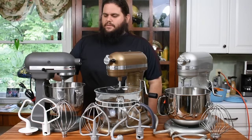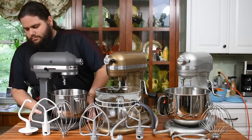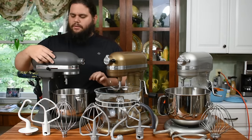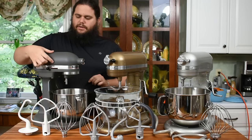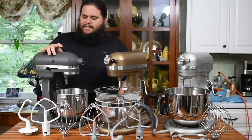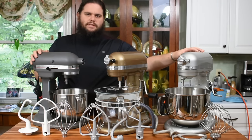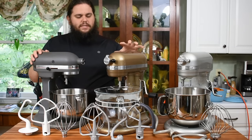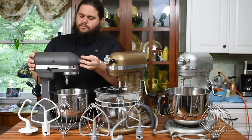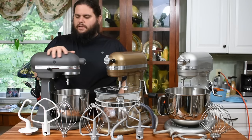This is one of my favorites. The look, feel, sound — everything about it just works. The awesome thing about this older style, which you also see on the modern-day Artisans, is these little black caps on the sides. These are actually the covers that hold the motor brushes and their springs — that is how easy it is to repair. On the newer models, the springs and brushes are internal and you have to disassemble the motor to service them, and chances are something else will break before then. This one has new springs and brushes, all the grease has been removed, and everything's been cleaned and completely redone.